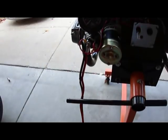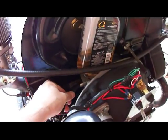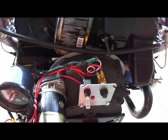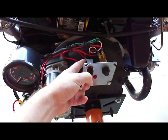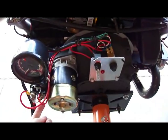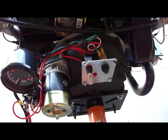What I did was I ran the battery line straight to the starter, and then the ground. I don't know if you can see it back here on the engine mount — so that's my common ground. Also ran a line from the battery cable over to my switch, and from my switch to the starter, starter to the solenoid. And the oil light I have onto the switch and my oil sender unit.